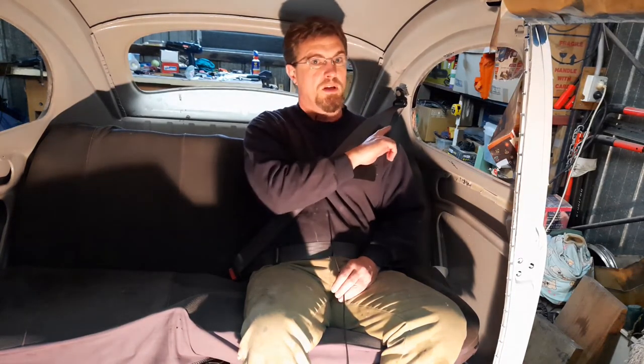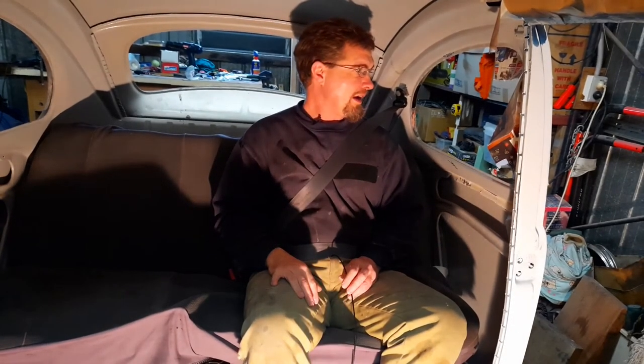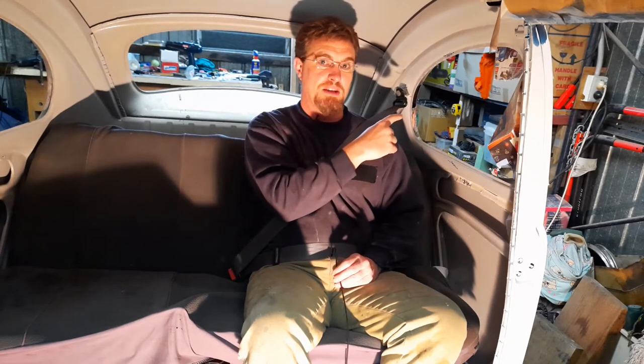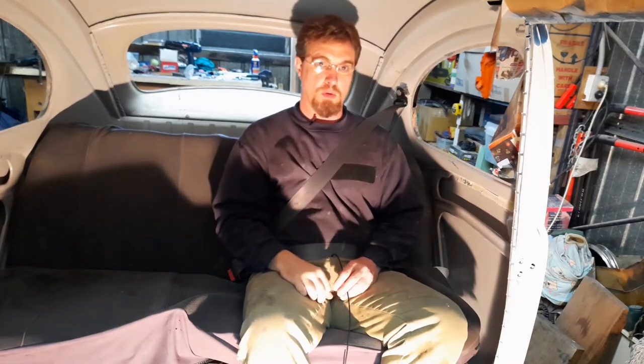Just a quick tech tip for when you're having to weld thicker steel to thinner steel. Doing it on the outside, it's not so much of a problem because you start on the thicker material and then drag the weld pool towards the thinner material. And then that normally works pretty good for me. When doing this plate and the plate down there, I found in the past, because it's trying to get the heat into the thicker material, so it's actually going to penetrate, and when you're working on a 6 or an 8mm hole to do a plug weld, that's not always going to work.